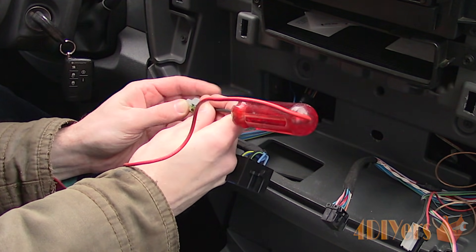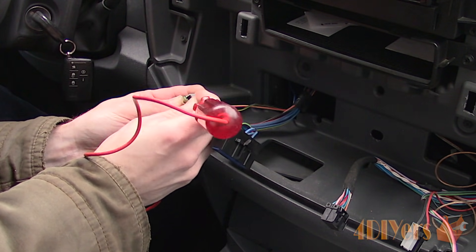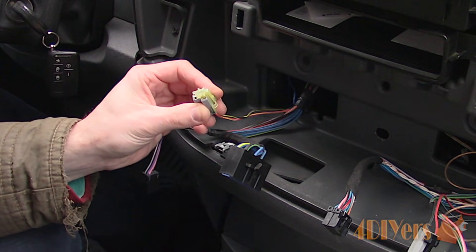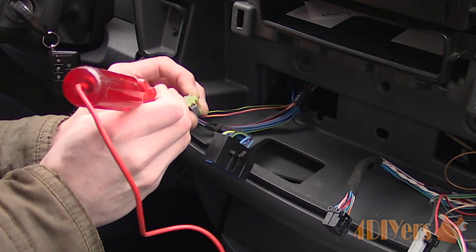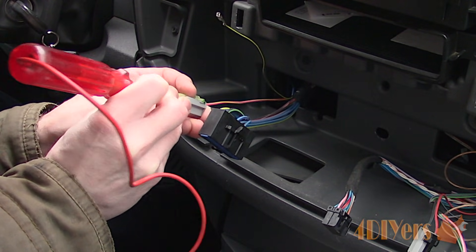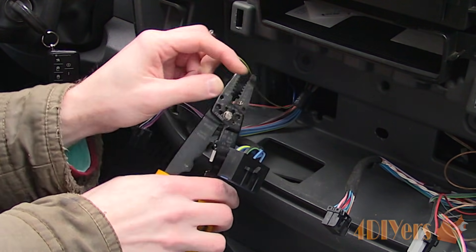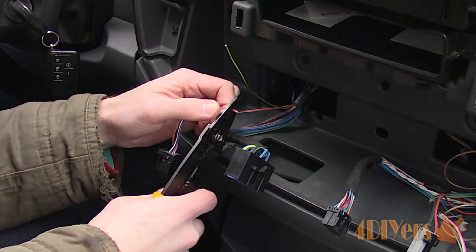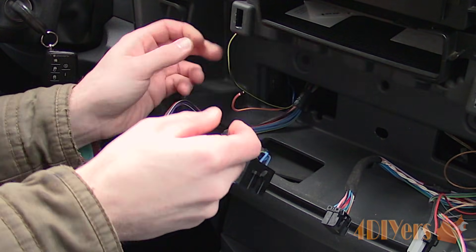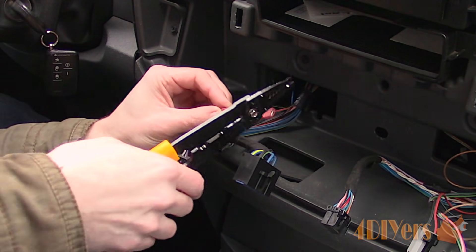With the key off, the connector casing can be removed and you may be lucky enough where the terminals connect directly to your new port. However in this situation that wasn't the case, and I also couldn't source a matching connector, so I had to cut the wires off instead. Slide the outer retaining frame on the connector forward — there are two tabs in the back that need to be disconnected. Once forward, this exposes the tangs on the inside; pull those away from the terminals then remove each terminal. The test light has a sharp enough tip to work great for accessing these tangs. With the connector removed, cut off the terminals, then strip the insulation so the appropriate length of conductor is exposed. Twist the wire strands, install the correct size crimp terminals based on wire gauge, then crimp. Always give a pull test to ensure the wire is firmly in place.